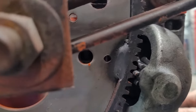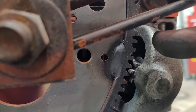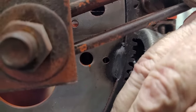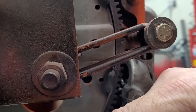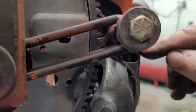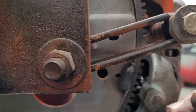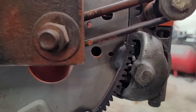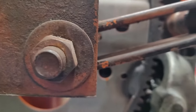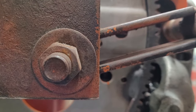Now if you didn't have this situation, you would need to put shims either to rock it towards or rock it away from the flywheel, or lower it — put a shim between the starter and the block to get it a little lower or a little inside. It's just a matter of playing with it. But I got lucky on this one — she comes out, and as soon as that solenoid hits, that's how much engagement we're going to have on those teeth. That's perfect.